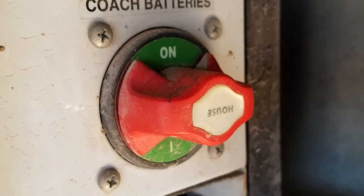If you store it for the winter, you actually want to remove the battery and bring it to a location where you can put a trickle charge on it out of the elements. Also, some people turn off the battery disconnect switch when they're not using the RV — you want to leave that on at all times. The only reason to turn it off is if you're working on something 12-volt related. Otherwise, leaving it off will cause the battery to slowly die down to a level where it may not be recoverable and may not hold a charge.